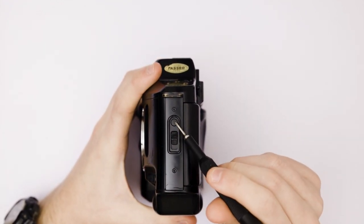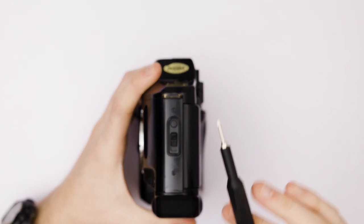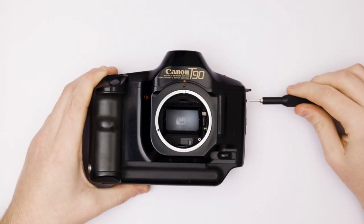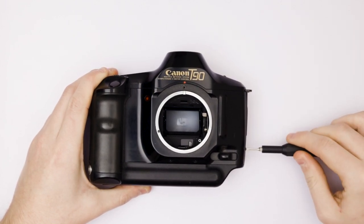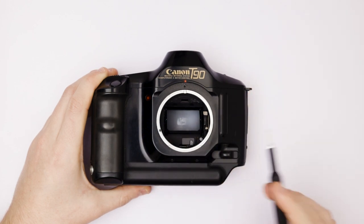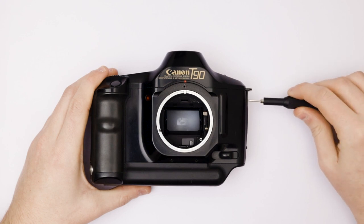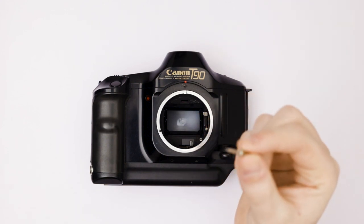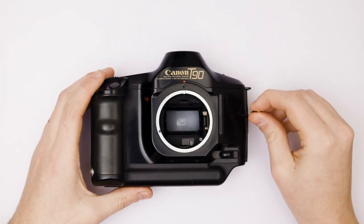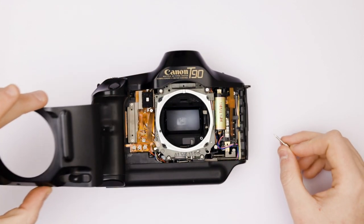This button is spring-loaded. What you can do is take these screws out just a bit and then try to easily bend this part up. Just take them out a bit so they don't turn completely loose. You can see that this part has started to get loose from the front panel. Ease up the screws enough so they don't fall off. Then take something small like a small screwdriver or something plastic, put it in between here, slide it through and bend gently upwards. Then you see this coming loose and you just put it to the side.